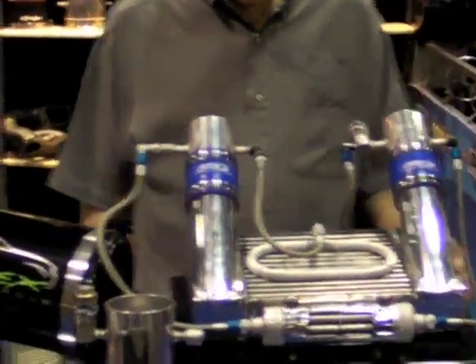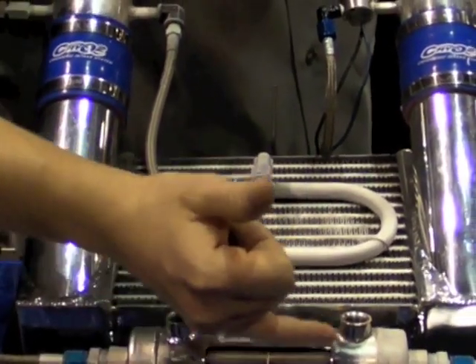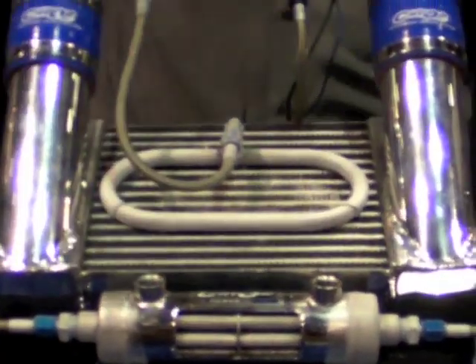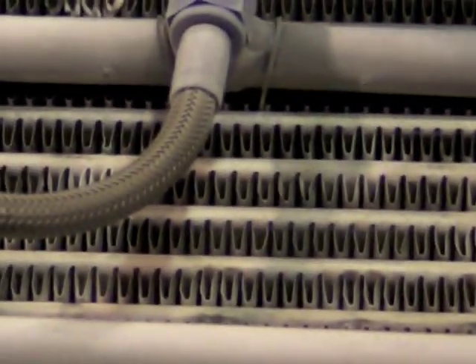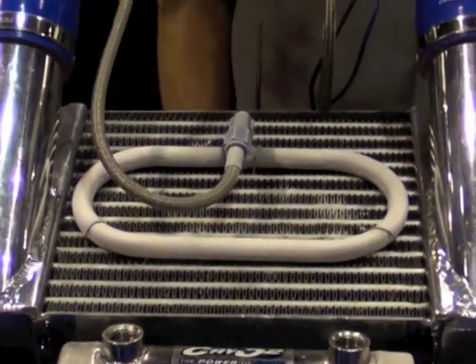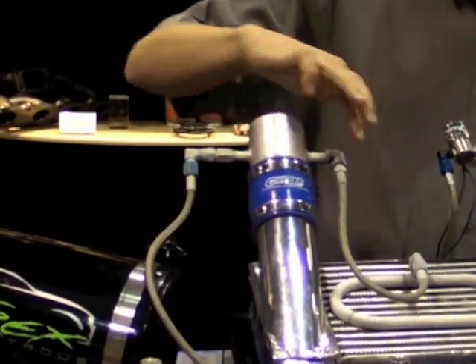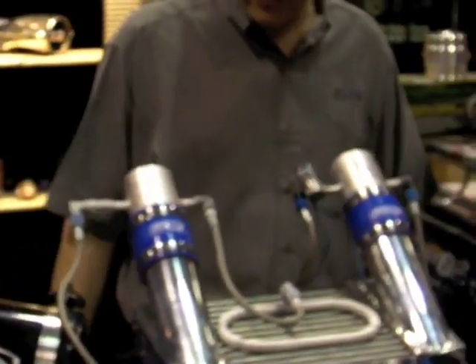Let's get a close-up on this here. Look at this — this is all frosted up. Is this a fuel chiller? Yes. What you see is an open area; that's where the fuel would be flowing through past all the baffling and then exiting out cold. Look at this — this whole ring here is all covered in frost, and that was instantaneous. And if you even notice there on the intercooler face itself, all iced up from the liquid CO2. You can even see on the air intakes how much they frosted over, and the outside of it even freezes out.